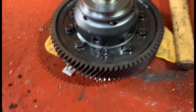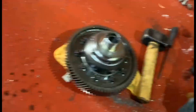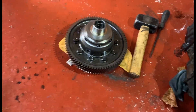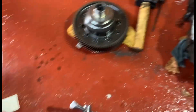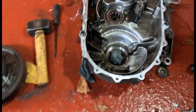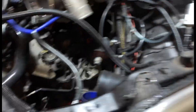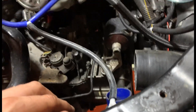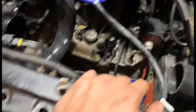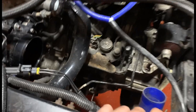The quaife is out of the box and it's on the final drive, so the diff is on there — that's the stock diff. Now we've got to torque these down using a vice, and then we've got the bearings to go back on the ends. We'll try and get the box back together, and once that's done we can focus on getting this one out and into the car. It's pretty accessible — I've taken all the main stuff out to get to it. Fingers crossed we can get as far as we can today.